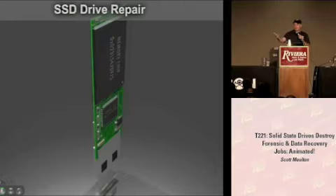Basically, what you're saying is: why not just image the memory chip instead? There are some complications there. We have actually done it — John Mushhammer, one of the guys who did a talk at ShmooCon, and I have gone back and forth over some chips. I set some up, he did some images. The hard part was all the virtualization of the custom stuff the control chip is doing. You don't know the layout of the content, so you don't know where the tables are or what's actually happening. It doesn't represent itself like text where you can just find strings and do something with them. And if there are multiple chips, you don't know how the content is divided up either. It gets a lot harder when you're dealing with a solid-state disk.